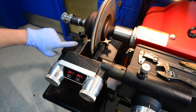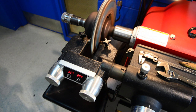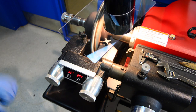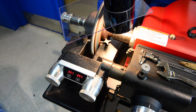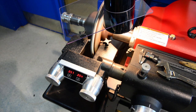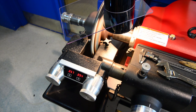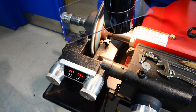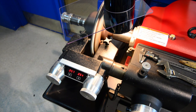Notice when we cut there are metal flakes that come up — flying pieces of metal that are very hot. You want to wear your proper PPE so you don't get hurt. In this case, safety glasses. We can also put a shield in front of it so that we don't get hit by the metal.